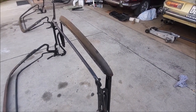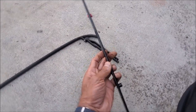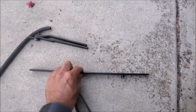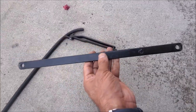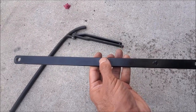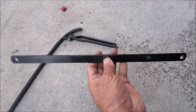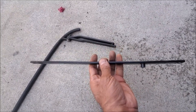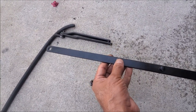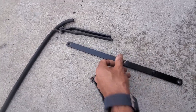Another thing: one of the rods that typically bends — you can see this isn't exactly straight. They typically bend at this bolt hole and it's quite difficult to get flat. A friend of mine straightened this as much as he could. Aldrich Trimming makes reinforced ones — I think for about 60 pounds you can buy reinforced new ones — so that may be an option.